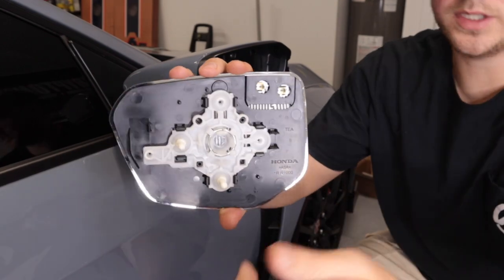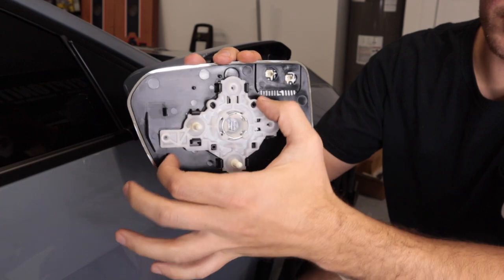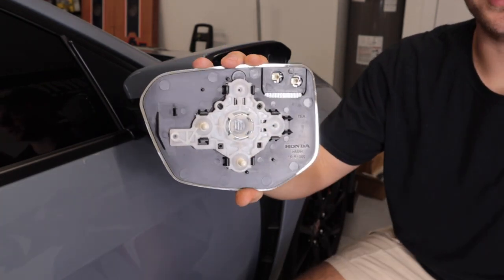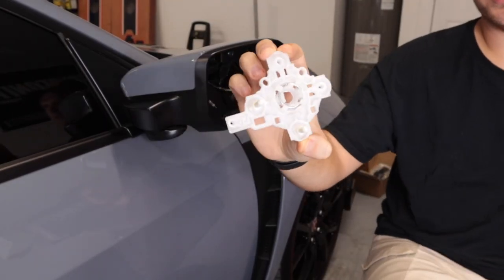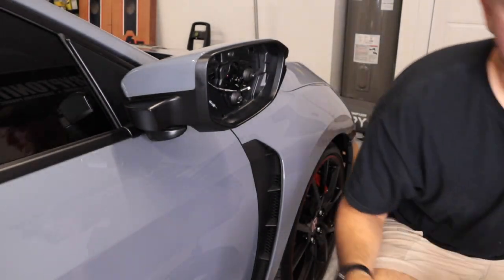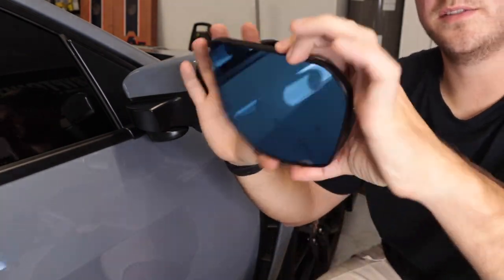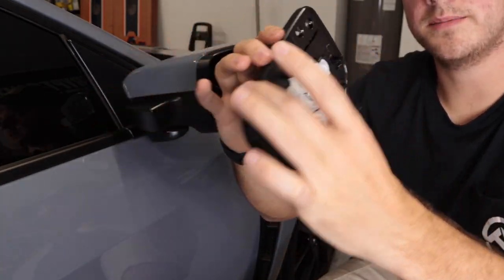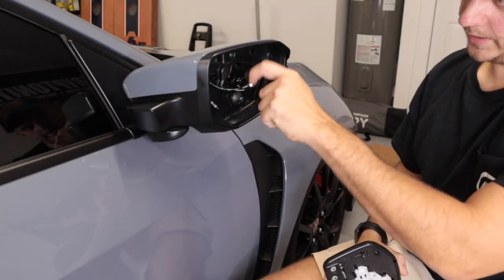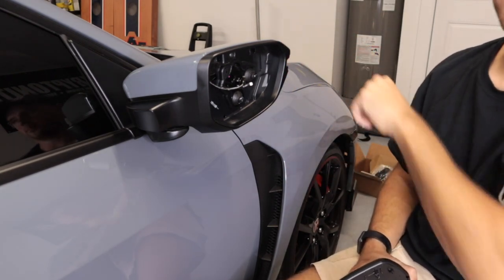So like I mentioned, you are going to take this piece out right here. You have these little black clips all around here — you're going to pry those out and then you're going to remove the white piece just like that. I'm going to be using the trim tool pieces from Acuity. This can be pretty difficult to remove, so just have some patience and it will come off. As you can see, I have it off. And all we're going to do is transfer it over to the new mirror. We have now successfully transferred over. I got some nasty fingerprints I need to wipe off. We're going to set this to the side and go back to taking some of these pieces off here so we can pop this cap off to get to the clear side marker for the turn signal.